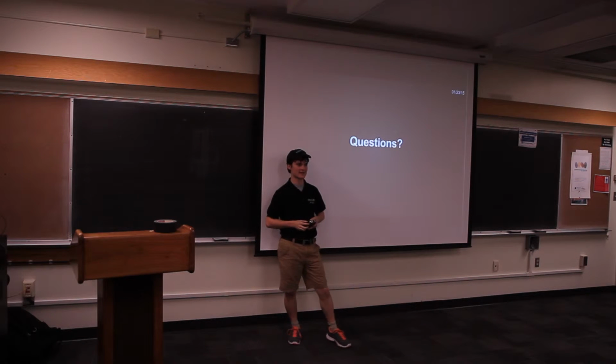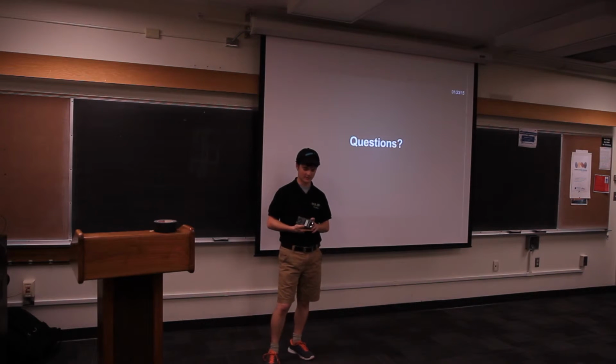So there are a series of steps to test what's wrong with the Tascam if it won't turn on. The first one is the hold switch. The next one is the batteries. It takes 3 AA batteries. And sometimes the SD card can mess up inside of it, but that's a rare thing that doesn't usually happen very often. But yeah, there's a hold switch. That's really the only switch that you really care about.